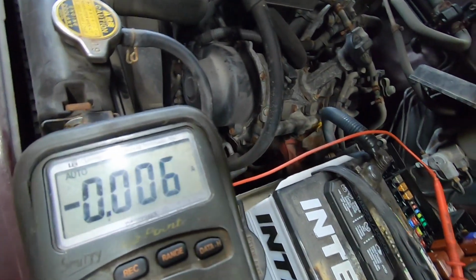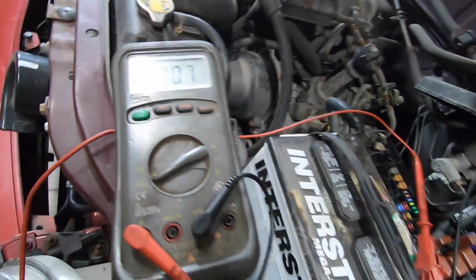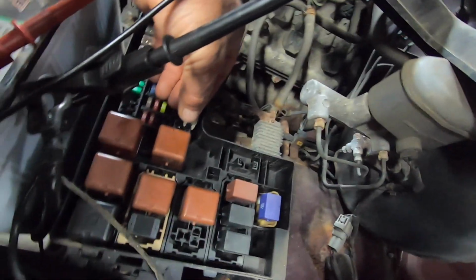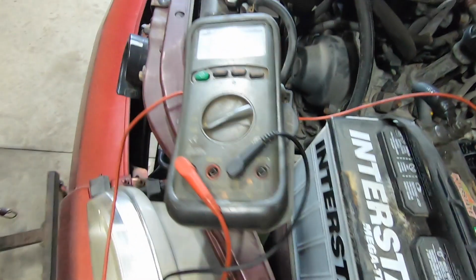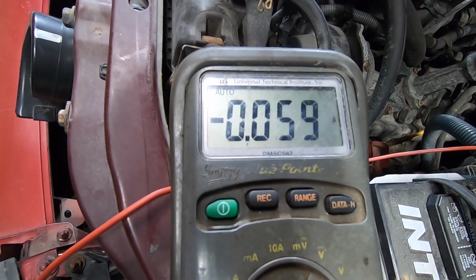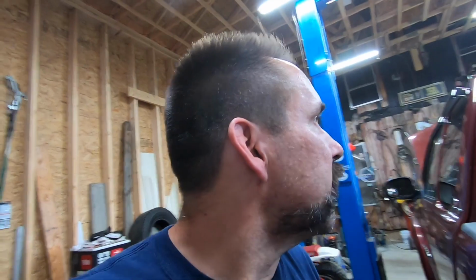Oh yeah, now we got 7 millivolts. Pretty good. All right, let's put that jumper back in, the short pin. Short pin goes here, if you can see. Make some sparks. And yeah, we're down to 430, 450. That's still kind of high. Oh, there we go. Something went to sleep. Fixed. Bingo. Well, that was easy. I got an easy one for once. That ain't so bad.